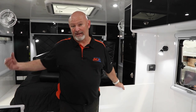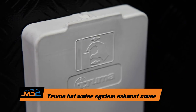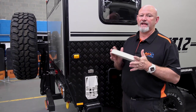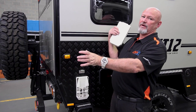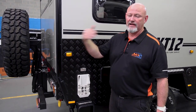If the red light comes on, you've just got to reset — wait 20 seconds, then have another go. If it still doesn't work after two, three, or four goes, you may have to take your burner inside or external to light it, so you may have to purge the gas through the system to make sure it stays lit — you might have one or two air blockages in there. Once you've turned your Truma hot water system on inside, this is your exhaust — open this up. Push your thumbs in, it splits the top and comes off. You must release this as soon as you turn your hot water system on. Come and check it at two minutes and eight minutes — check with the back of your hand if heat's coming out. If it's not coming out, redo it, because with lines that aren't purged properly, it'll light and then go out. You might have to do it two or three or four times so the air comes out and the gas comes through the lines.